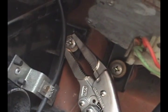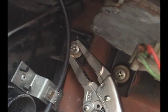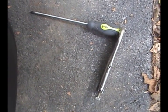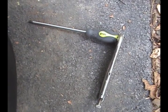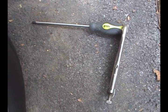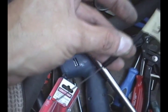I believe there are six screws holding in the heater core. First thing you want to do is NOT strip these screws and then have to drive to Sears and buy a $20 pair of vise pliers. Make sure you have a screwdriver that's fat enough for these screws before attempting to take them out — they're pretty tough. The ones on the left are extremely deep in there; if you strip those, you'll probably end up selling the van. So I made a very special high-tech tool to get the screws out on the left-hand side. Make sure you label these.